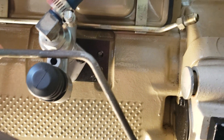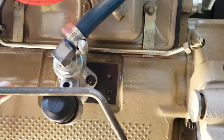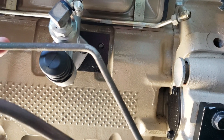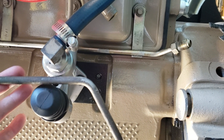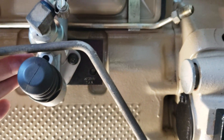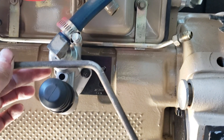I got the angle right to come up here where it would go just between, just kind of a hair in front of the pump. It bends to go straight forward again. Once I got that angle right, I wanted to be able to clear the pump here at full throttle. So the bend needs to be back about an inch and a half or so from it. That way I'm not worried about it actually contacting the pump even if the motor flexes or the frame is flexing. You want a little bit of space.